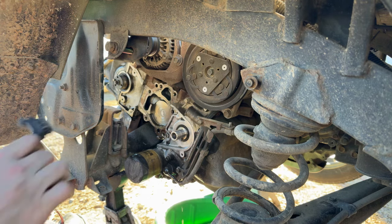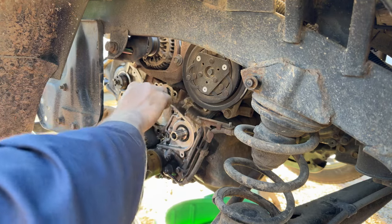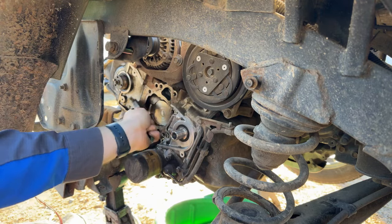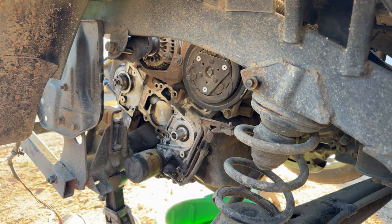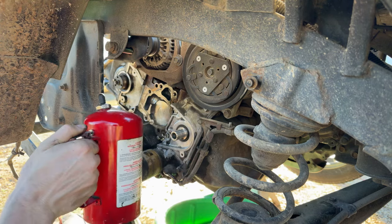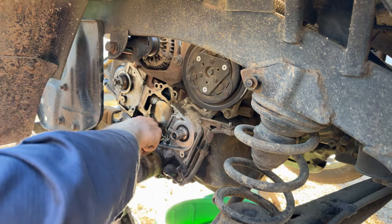So we'll get in here with the scrub brush around the water pump, but we're gonna have to go get the die grinder and a 3M bristle disc to really get this crud off of here. I need to get a blow gun too and blow out these bolt holes for the water pump bolts. Don't wanna hydrolock those and crack the block down in there.